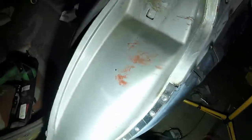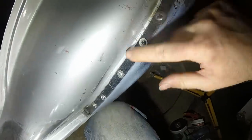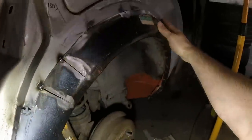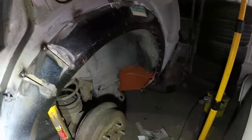And where I did have a big gappy seam in there, that is now nice and tight. So I'm going to weld these bits where I cut sort of compliance strips, and then I can undo these one by one, plug weld the hole, and then do the next one, and hopefully all of that should stay in position. And then I can weld the rest of it, and then the last little bit will be closing up the final seam and then welding it.